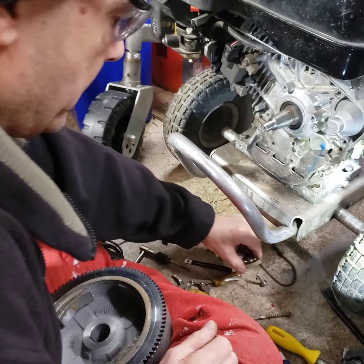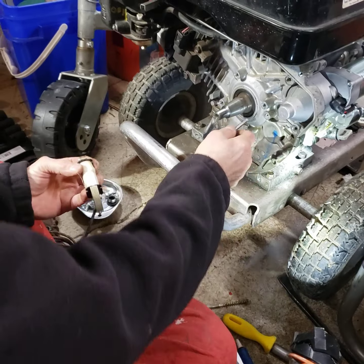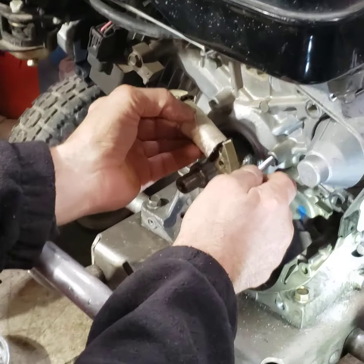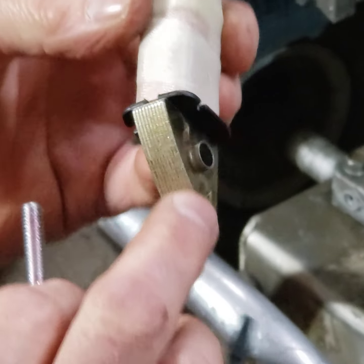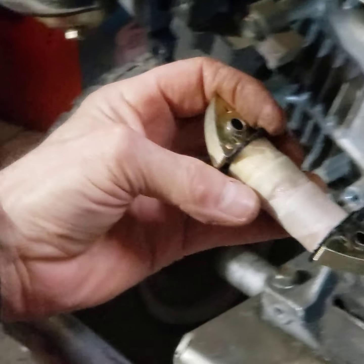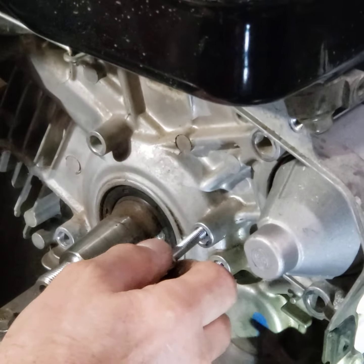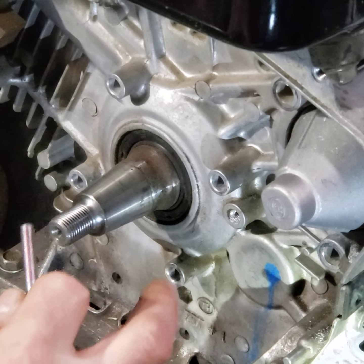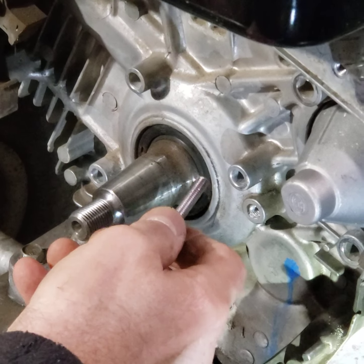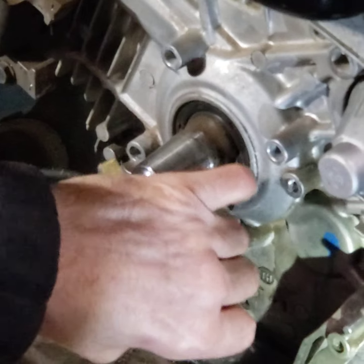The other thing I'm seeing online: you have this unit here — this mounts up in here. This is the charging coil and there are two sides to it: a nipple side and a non-nippled side. The nipple side has to go in and should sit inside here. The problem with these holes is the threads are going to be corroded — you're going to have to tap them out before you can install this.